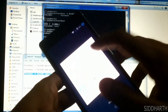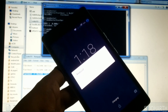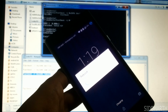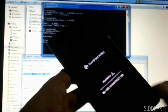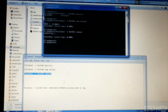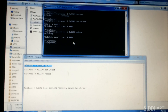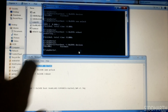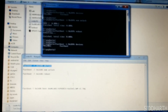So now again go into the reboot and reboot into the bootloader. So again we are in fastboot mode. Copy-paste the first code again — if you get these keys on fastboot you can proceed further with the flashing of recovery.